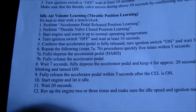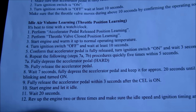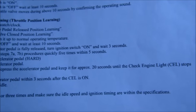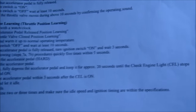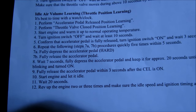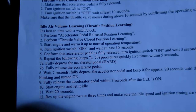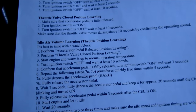After that, step eight says wait seven seconds, so at 15 seconds — as I showed on the clock — you completely depress the pedal to the floor. In about 20 seconds, the check engine light will stop blinking. It starts blinking at about 11 seconds and stops after 20. Once it's fully solid, that's when you start the car, then wait 20 more seconds.